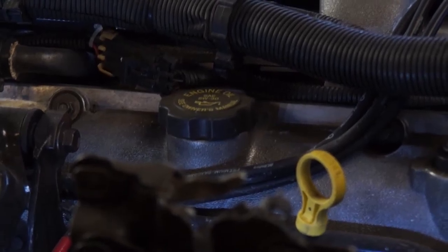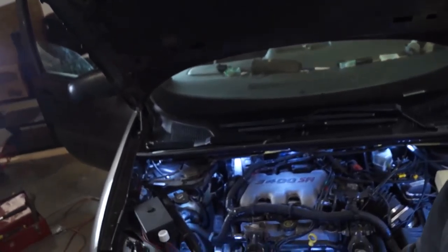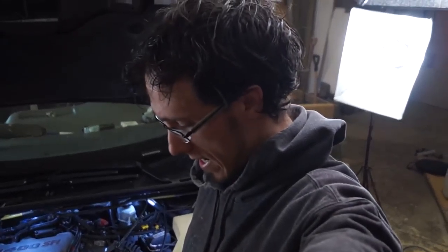So I just pulled back into the shop after running some errands, and I noticed on the shop floor that I've got oil drops. It is engine oil, and it's leaking out of my engine. So I am going to have to take a closer look. I think I know what's causing it. It's most likely the oil cooler, which I had my friend Richard Lozo weld up and seal shut because it was broken and it was pushing oil into the coolant.